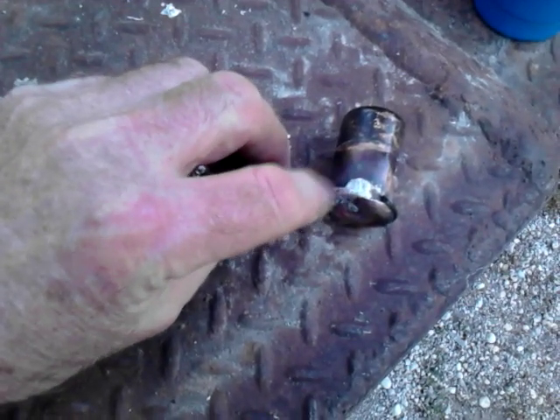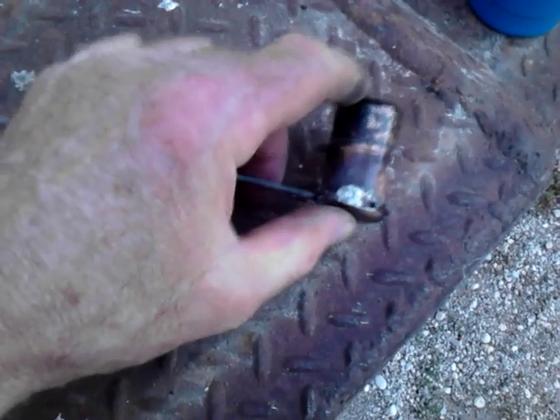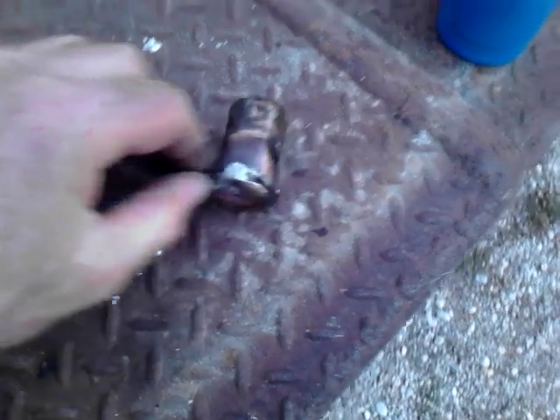It's just kind of a little tricky — you can turn it and get it out. This one had a piece of rubber on it; I have no idea why. So this float had a big hole right here and I had to cave it in some to get it close enough so I could solder it. Then for the soldering, I just had to give it a touch with this torch, like that.